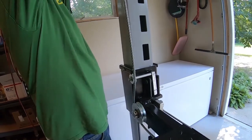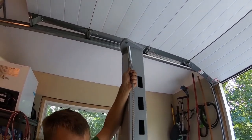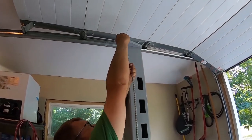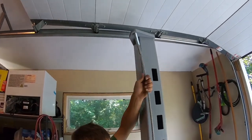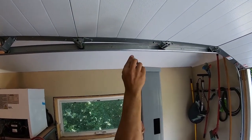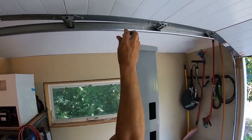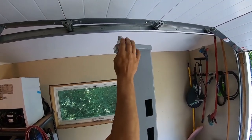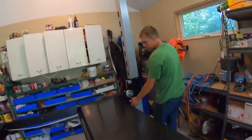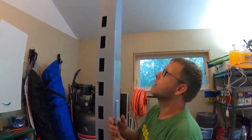So you get your cable up through the hole and put your nut and washer on. Any more, Dane, or is that it? It's hard. Okay. It's good enough. And then you go and do the same thing on all four corners, making sure that your cable routes around this side of this wheel and around your secondary latch like so.